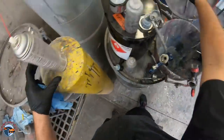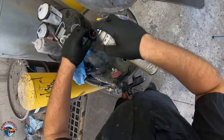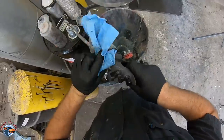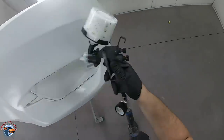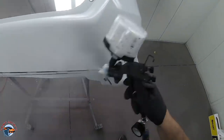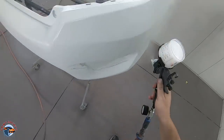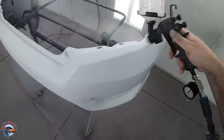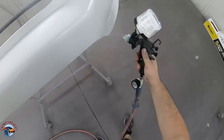One more time we're going to clean it out — you can see the efficiency here, and this is in real time. We just finished spraying our silver bumper covers and I need about 10 to 15 seconds to get this thing back in the booth and we're on to our next project. We're blending out the color — this is NH883P, Honda's newest color. I actually think the color we have matches better than what they have on the factory. This is the pearl coat too — we did two coats of base and two coats of pearl, and it blended out no problem. Another good test for the gun — seemed to handle it pretty efficiently.